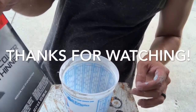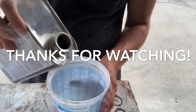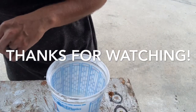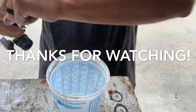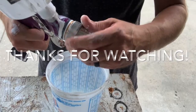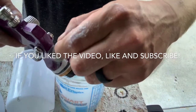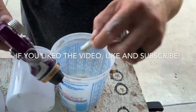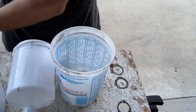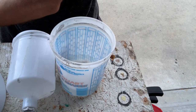Now we're just taking some thinner and putting it into our paint mixing bucket, then taking our spray gun and taking all the little bits and pieces off of it and letting the thinner do some work. So next time when we go to use it, it'll be fresh and clean. In these guns there's a little plastic piece and that's what causes things to get gummed up, so you can just wipe it off one good time, throw it in your thinner, and that should help remove a bunch of the gunk that's built up on it.